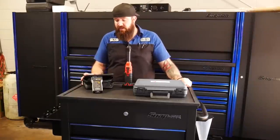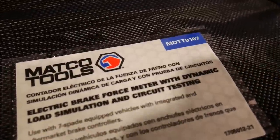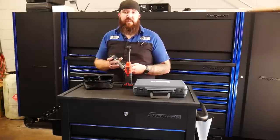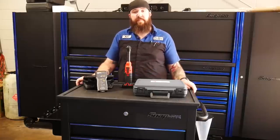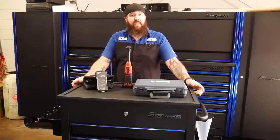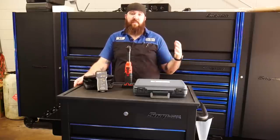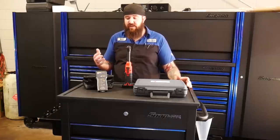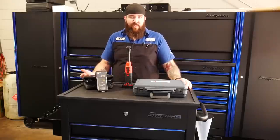Third on our list, we come to another MATCO tool — it's the MDTT 9107 electric brake controller and force meter. This brake controller tester is going to be testing everything from the lighting to the brake controller output on all of the newer style trucks. The issues between older and newer style trucks is that the newer ones have controllers built into the actual truck. They have CAN bus systems and then they also have the output, which is pulse width modulated to the battery plus as well as the brake controller to the rear trailer brakes. The newer ones have these controllers and also have reference feedbacks from that pulse width modulation, so these are able to read that correctly — that the ECU output and the circuitry is working correctly. And it's also able to work with older vehicles as well.